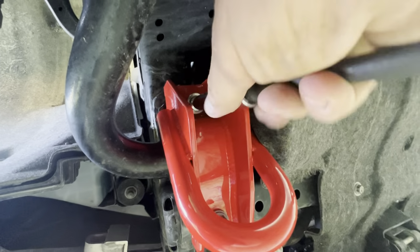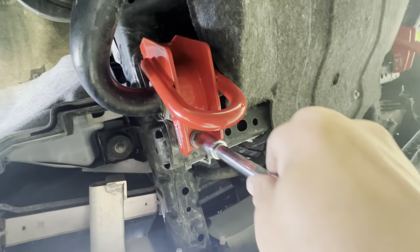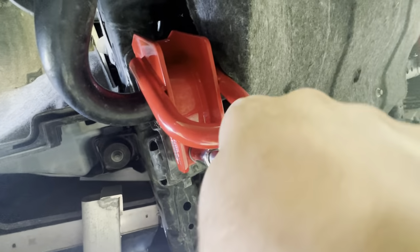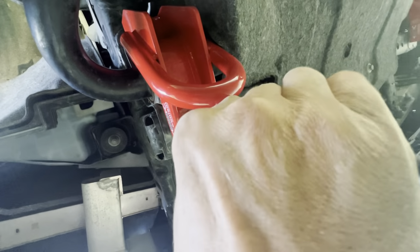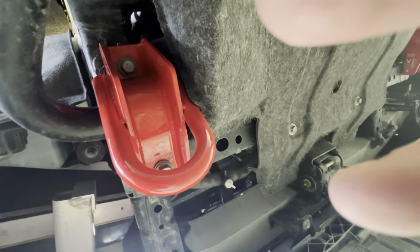And you put the bolts back in. Get your bracket up there and start the bolts by hand. Don't just start pumping them in there and strip those threads, because you know what happens next. A one-beer job turns into a lot of cursing and swearing, and a couple-hour job because you have to re-tap it. So don't do that. Once you're started in there pretty good, you can grab your impact or your ratchet and snug them in.